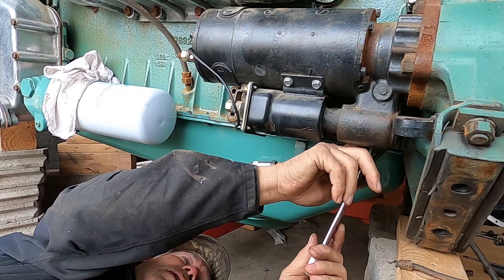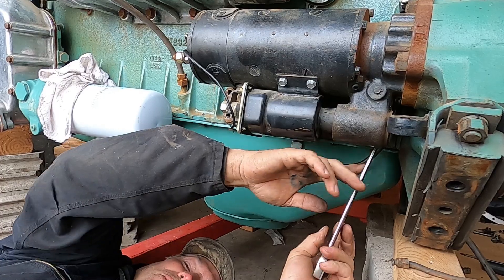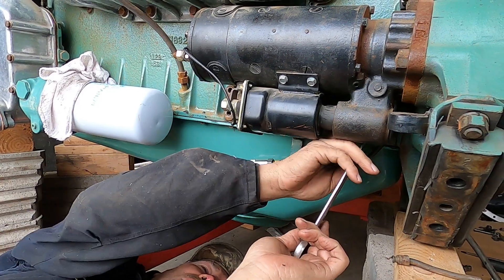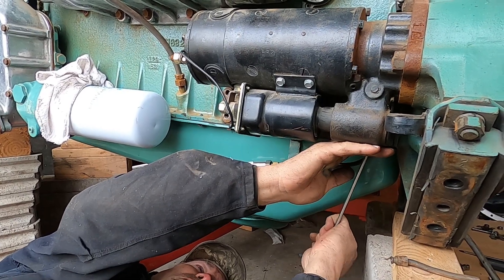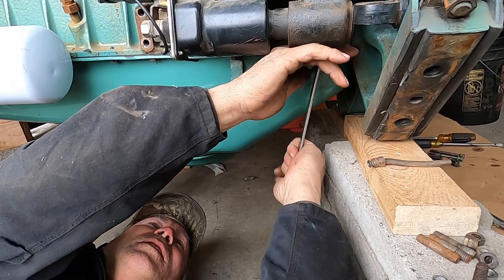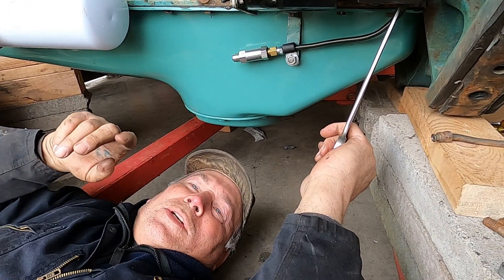I know they're all brand-new piston rods and everything. Did you look at them? Oh yeah, I looked at all that stuff. But it's all old. And if you're going to build a turboed engine, you want to step up and just change the rods and the cylinder kits together. I want to look at one of them and see what port liner they put with them. Because turboed stuff actually takes a different liner than what normally comes with them. You can look at them through the inspection plate. The air box covers are a friend — when you look for bad parts, you just open the door and look inside and go, 'Yeah, that's bad right there.'